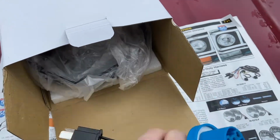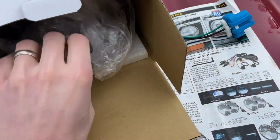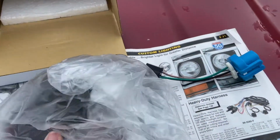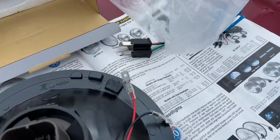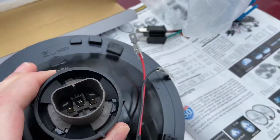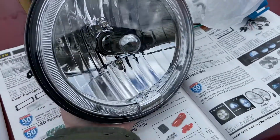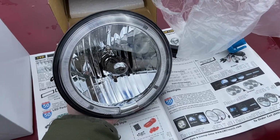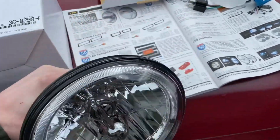The one thing I ran into, you'll see halfway through the video, the high and the low beams had actually kind of switched. So when I hit the dim indicator switch on the floor and the indicator was on the dash, that was actually the low beams. So then when that was on regular setting dims, that was the high beams. But anyways, I just found which common ground was and switched over those wires accordingly.